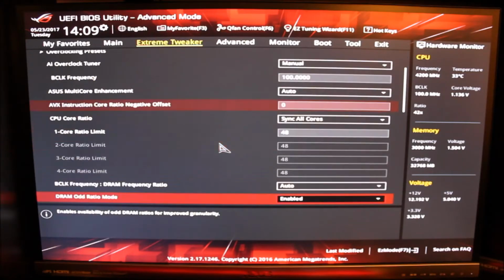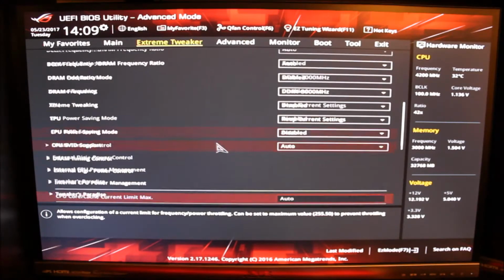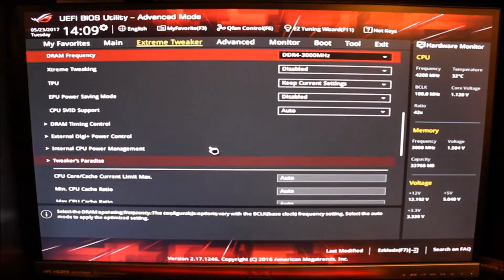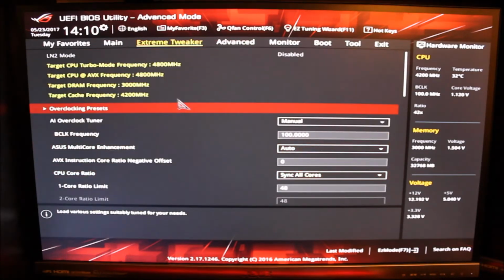And as you can see here, there's not a lot really changed. Like I said, just a quick dirty overclock for now. I may mess with the voltage later and see if I can keep it in the high 70s max on thermals, and just play with the voltage and everything. But for now, I'm just going to do the overclock of 4.8, and I'm going to go from there and see how everything goes. Alright, so let's boot this thing up and see what we get on thermals and some benchmarks and everything else. Let's do it!